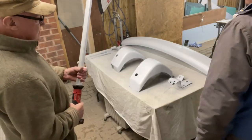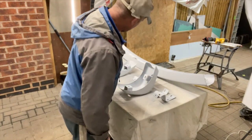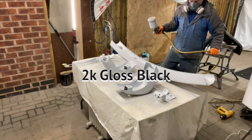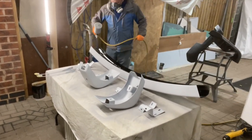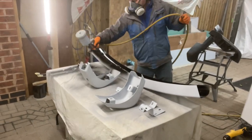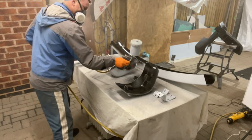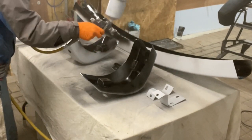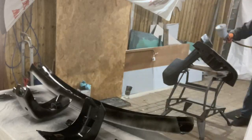They look nice. I'm really pleased with how the primer has gone on — got it really nice, all covered. So let's get some top coat on there. This is the moment I've been waiting for, I just love putting top coat on. I've got this thinned down with some thinners so it's going on nice and smooth. I'll just keep building these layers up — just go over it once, go over it twice — a thin layer to start with, a little dusting. Just as long as I've got a coating on there, then just keep building it up as it dries until we've got a really nice sheen. You'll just see the shine coming through as we keep putting these layers on. This gloss black — and these are the side steps as well, the plastic ones — we've primered them just like all the rest.